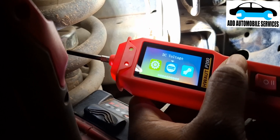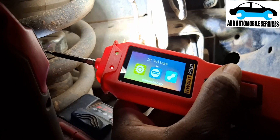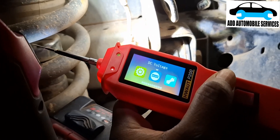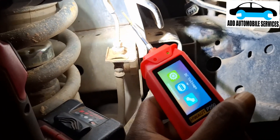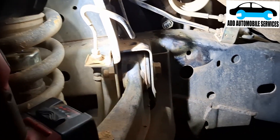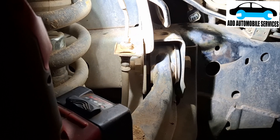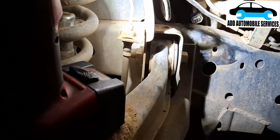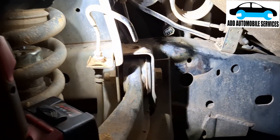That's the main reason why I got this one instead of the one I was using before. It's a Chinese brand and so far, so good, it works as I want. I'll replace the crank sensor, but before that let me show you the signal. I have cleaned the crank sensor — when I removed it I saw a little bit of iron debris around it, so I have cleaned it.